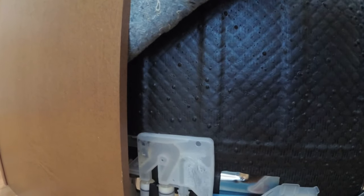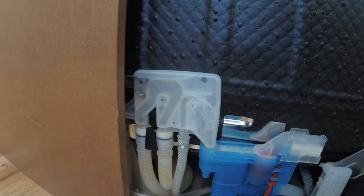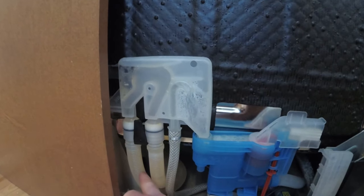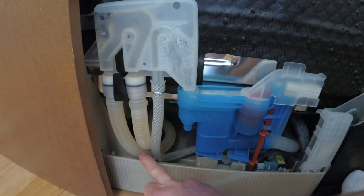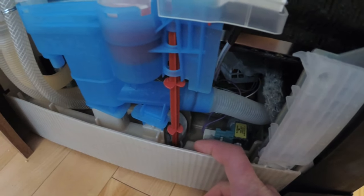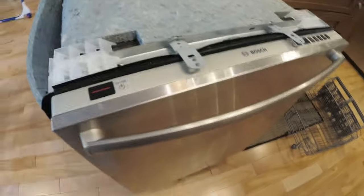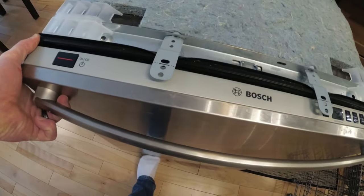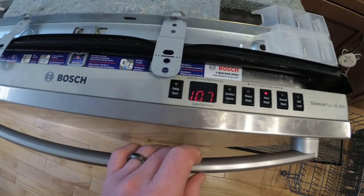I found something interesting — this is the water manifold. There was some gunk in that corner but cleaning it didn't make a difference. Connected to it is a pipe going to the drain underneath the tap. Underneath here, that white piece is a float that activates a red rod. If there's water in the bottom, it pushes up on the rod and starts to pump water out. We can actually trigger that by turning it on — you can hear it starting to drain.